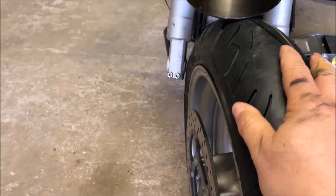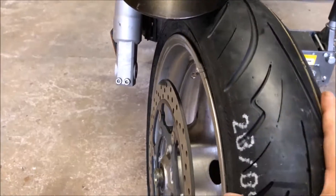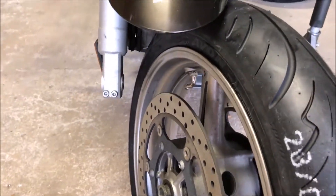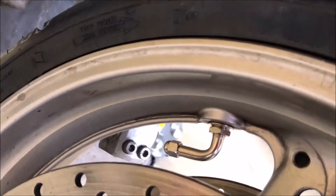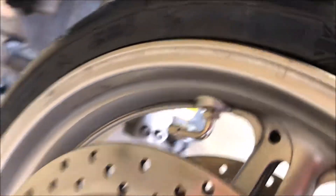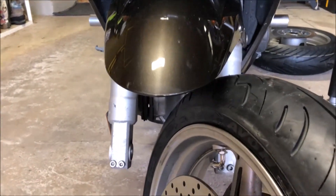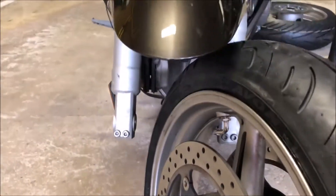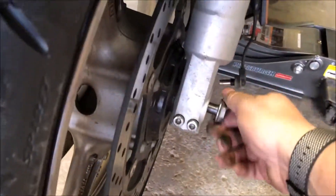Now this will go right in, and if you're like me you'll notice it's just a little bit off — the motorcycle isn't up high enough, so just tip it to the side a little bit and it'll go in. Notice I have new metal valve stems — they're angled because I am going to put a tire pressure monitor system on this eventually. Put this on, put the axle in, and then we'll be ready to start putting the brakes back on.